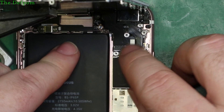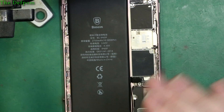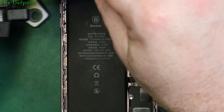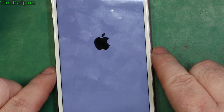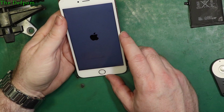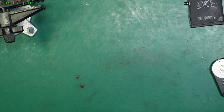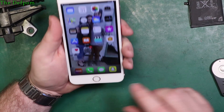Okay, you have a screen - that's a good start. I'll just check touch to make sure that works. Touch is working. Let me put the code in - home button's working. Okay, we're in - so that's unlocked. Touches working, whole screen - yep, it's all good. I'm happy with that. Let's turn this back off, then we'll put the plates back on again. Before I do that I'm going to take the battery back out, because if I drop it in the wrong place or possibly short something out, it would be very bad. That's a precaution.